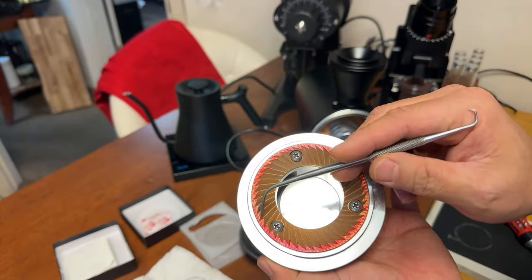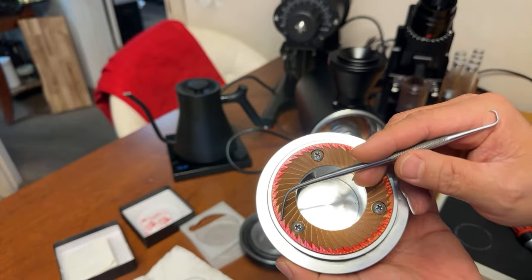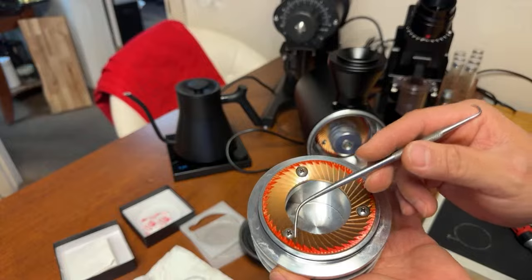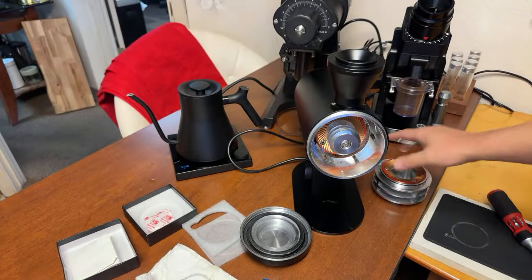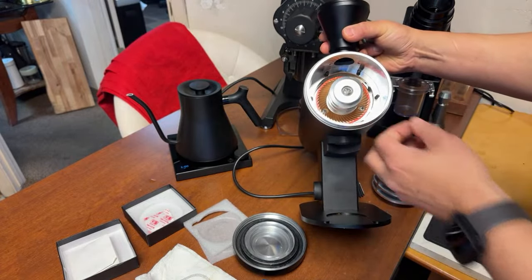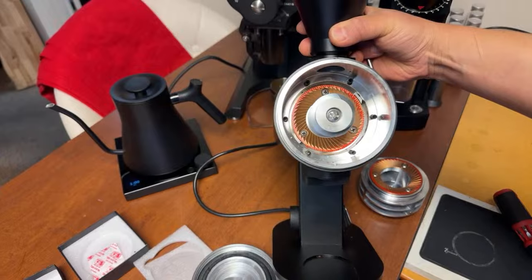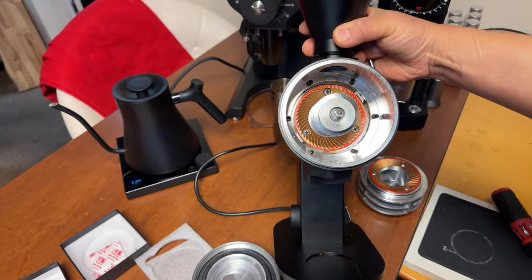So I'd say about 80, 85, 90% wiped, with just a small section right there. So that's not too bad. I consider it pretty good. Pretty good success on that. Alignment is pretty decent. Looking at the bottom, the bottom is pretty much wiped, as we can see. I see a little bit on the top, pretty good. I see about 85 to 90% wiped.